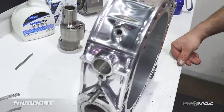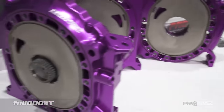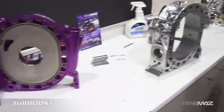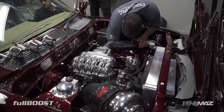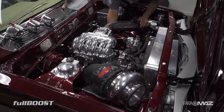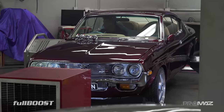That's why we've got the extra bearing support to help it on its way. This will make a comfortable 1500. Everyone talks horsepower, but if you've never experienced a 20B, it's like a small block versus big block on the street — instant torque. We've just done one recently that makes 800 horsepower through the auto at the wheels — 950 horsepower at the flywheel, and it does it pretty easily on about 20 to 22 pounds of boost.